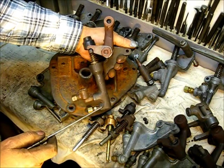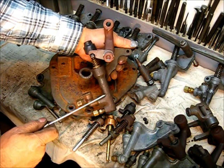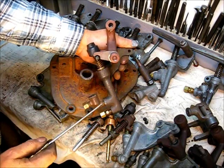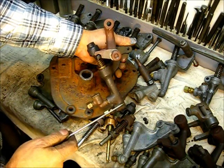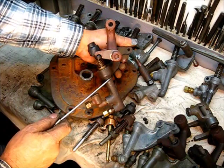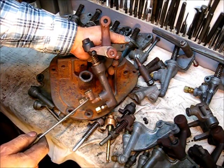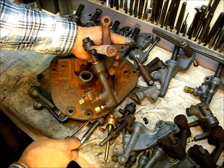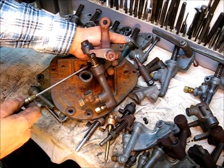Once you have disassembled one you'll understand how it works. Fuel comes in the bottom — the plunger comes upward, and when it comes upward it sucks the chamber full of fuel. The little ball in the bottom is checked going backwards so it can only go one way, filling up this chamber. On the down stroke it wants to push that fuel out — this ball down here prevents it from going back to the tank, and this one here is free-floating so it can push up to the mixer. That's how it works.